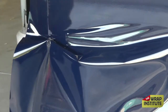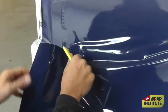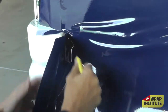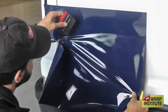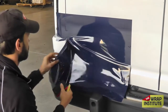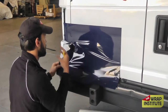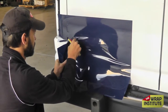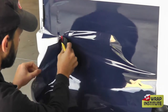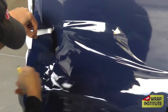Take your knife and make a relief cut out. By making the relief cut short enough, when it swings around it doesn't come long. Look how easily it wraps around the base. By picking the material up, it just glides around the top of the hinge and then you tuck it into the front side of the hinge facing the inside portion of the door. From the base of the hinge, make another relief cut right on the base so you can come back and clean that up later.